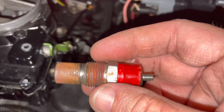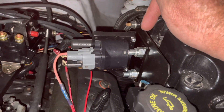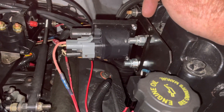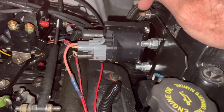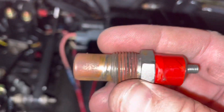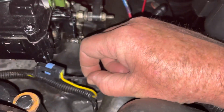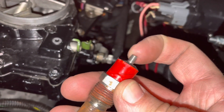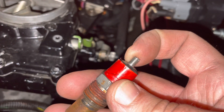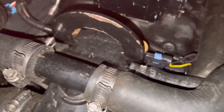Unless you can source one from another place, there's a way you could keep the Thunderbolt 5 module in the boat — keep it powered with the purple wire, keep it grounded, keep the tan blue to it and the yellow wire to it, and cut everything else. But to me that's just not a clean installation — you'll have the ignition coil, the Delco distributor, and the Thunderbolt 5 module, which just makes it messy to save $100. So the right way to do it is to install this switch in place of the sensor. I'll cut that yellow wire and put a ring terminal on it to fit on here, with a number 10-32 thread size and a nylock nut to keep it from backing off.